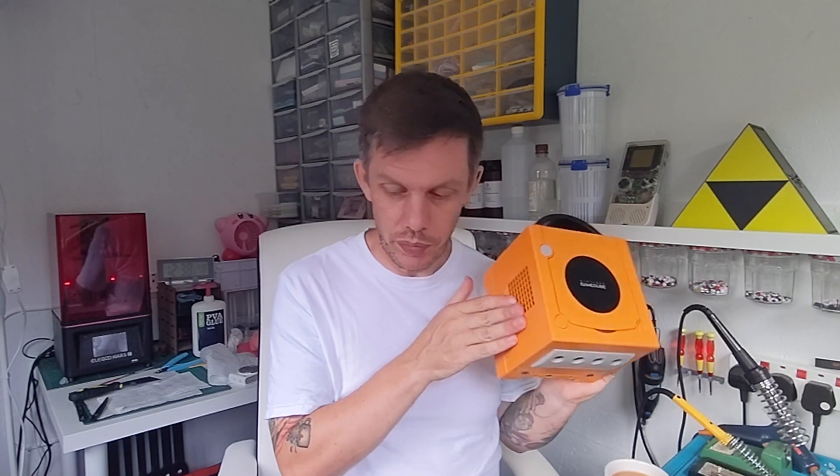It's not like PlayStation 4 loud, which sounds like a jet engine taking off, but finding out that there is a mod you can do, I thought as always I want to try it out. I've found this online - which I will link in the description - it's on Thingiverse and it's an adapter so you can put a 40mm fan inside the GameCube, which previously uses a 50mm fan. This is a Noctua NFA4x10, which is the fan that was recommended for doing this job.